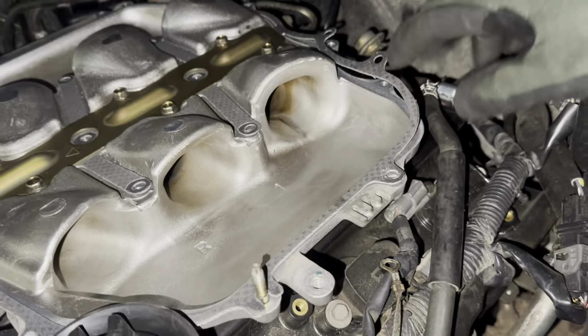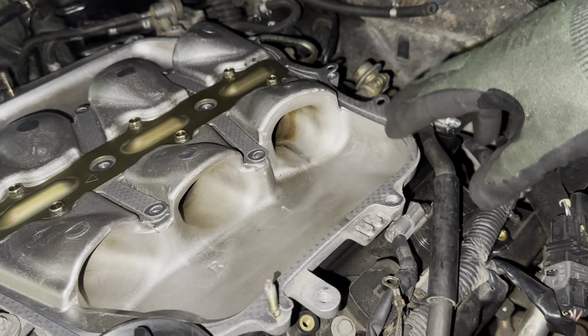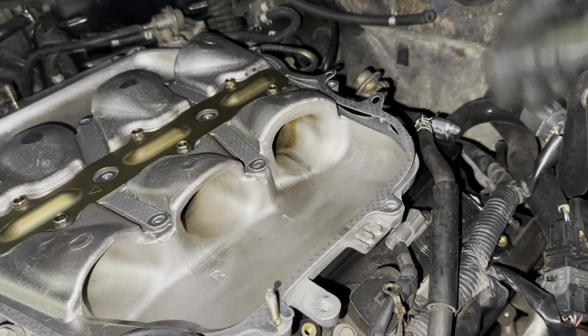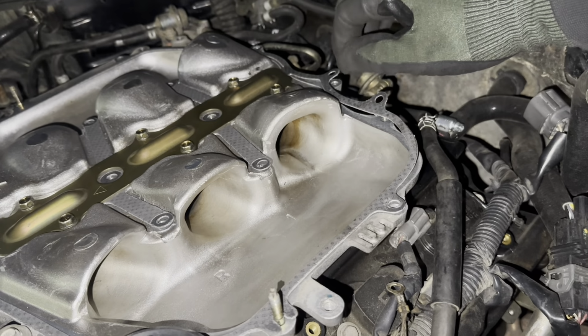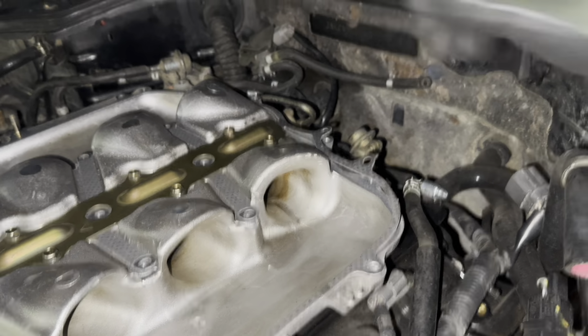And then what you do is put the KINETIX plenum back on. Like I said, I'm gonna see if I can use this gasket, if everything lines up pretty good. If not, I'll have to get the RTV and put it around here and it should be good. I don't know, see how this goes, because it fits straight up to the KINETIX, so I think it should be good. So I'm gonna put you guys down and get the plenum and put it on.